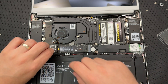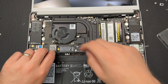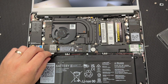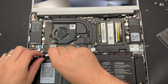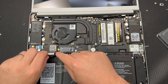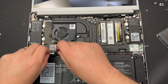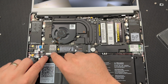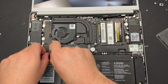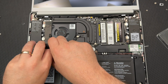Double check that the battery pins are straight. Look, I'm not judging either way, but yeah, they look... Yep, okay. Here we go. Don't plug in the battery connector if they look bent. Yeah, that's fine. Reconnect carefully. Slide in without letting the connector twist or bend. All right. Let's get everything in place here. Rip from both sides. Slide straight in. Okay. Being a little extra cautious here. All right. There we go. Feels like it's on the way.